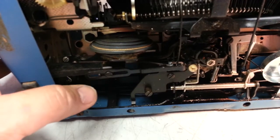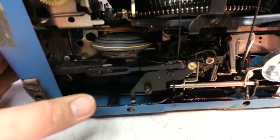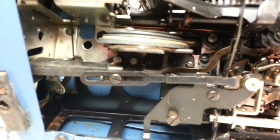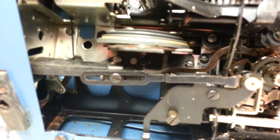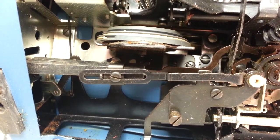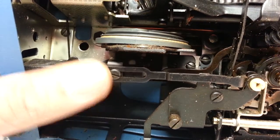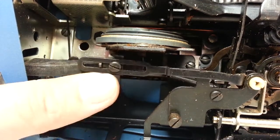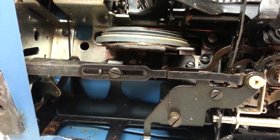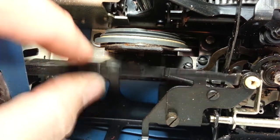It's still touching. You can see this piece moves still. I'm going to return. Hard to see it move, but it shouldn't be moving when I hit the carriage return. See it move just a little bit. That is not supposed to be moving because it's touching. Still needs to go up. Understand what's happening here exactly.